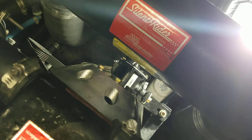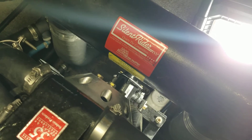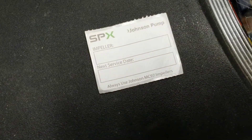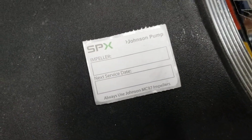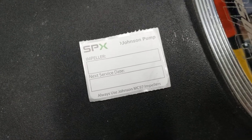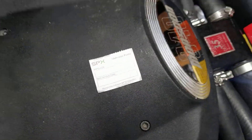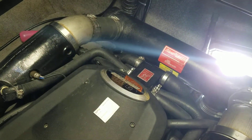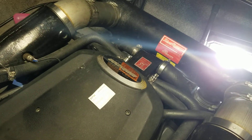And that's it. My personal recommendation about changing the impeller is to do it at the beginning of the season, not the end. My main reason is that I don't like that WD-40 to sit on that rubber raw water impeller all winter long, because it could deteriorate, warp, or change the shape of it. So I recommend doing this at the very beginning of the season, shortly before you're going to get this thing in the water or hook it up to a fake-a-lake. Thanks for watching — be sure to subscribe and share.